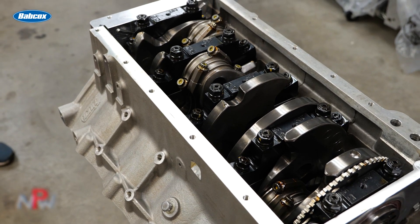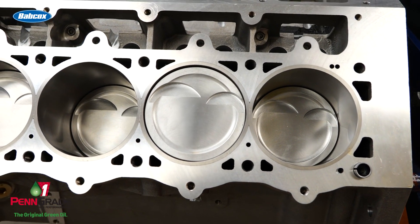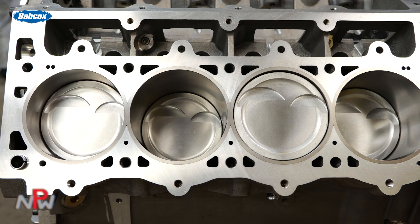This has a Bryant eight-counterweight all-radius pin-arm crank. It has Dyers rods and Wiseco pistons. It has a small dish because the chambers are so small — at this engine size with a 40cc chamber, we end up having a dish, but that doesn't usually hurt anything. These pistons have very small rings — I think they're eight-tenths millimeter rings and a two millimeter oil rail. They're very light, 3D milled, and I think these pistons weigh about 410 grams. They have a little tool steel pin. I think this has a bob weight of about 1,600 grams, so it's fairly light even though it's big, and it's all biased towards endurance.